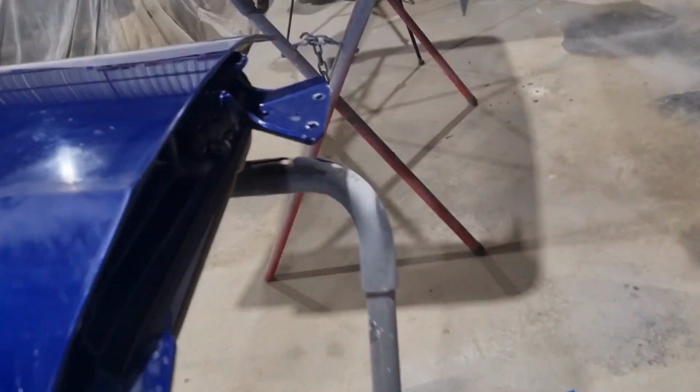That's just base coat. So now I'm going to sand all that back flat and put a bit of clear coat in it. See how we've got a little bit more paint in there. Still got it. See where I've rubbed through the clear there. Shouldn't worry me. Once I give that a coat over top, it should cover in. See, there's a little bit more. Still a little hole in it. So I've got that paint chip fixed, I think.